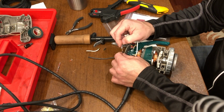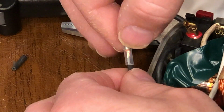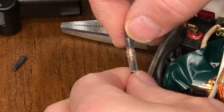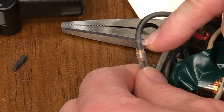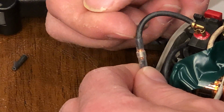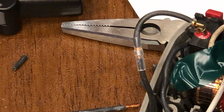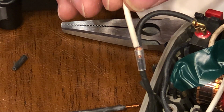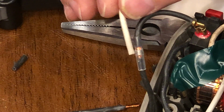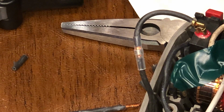The trickiest part when you're inserting this is that all the strands go in. So what I'm doing is inserting the wires, and because I loosened them, the wires are going past each other, if you can envision that. And you can see that the heat shrink tubing is also covering part of the insulation, and that the real business end of the connection is going to be this soldering joint right here. And you can see that there's just a little bit of copper wire showing on either side, because as this solder melts, it's going to ooze and fuse this entire segment of wire.